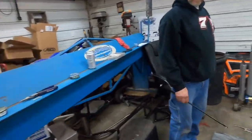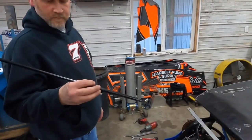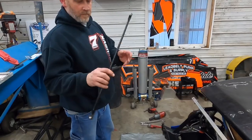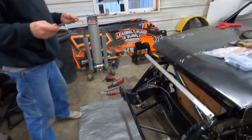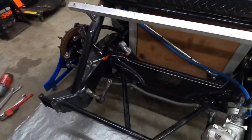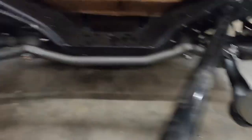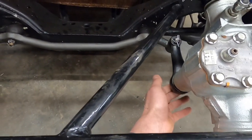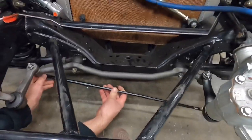Brian's got this fancy tool — body shop guys use these to go point to point and it tells you if your stuff's lined up. It's a fancy little slider tool. What we're going to do is pull a measurement off of this center link grease zerk to grease zerk, then measure from the idler arm to the center of the pitman arm and make sure that's all true. If it ain't, I'll show you how to adjust it, but this is your starting point for your toe.